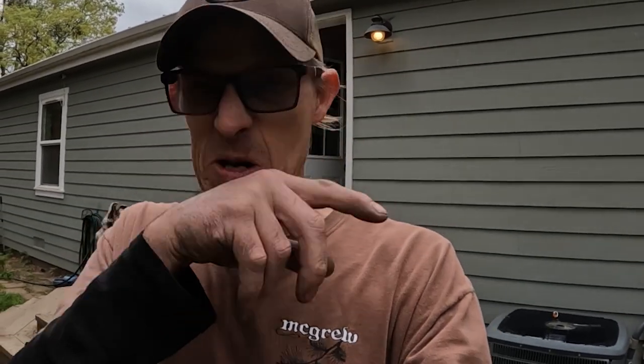So other than that, appreciate you watching. Hopefully you can take something away from that. Like I said, the big thing with tensioning the rope is when you actually have to go use it, it won't pull onto itself, and what'll happen, it'll lock, and then it won't unspool either way, and it just can be a total pain.